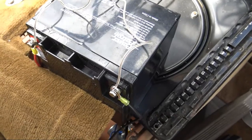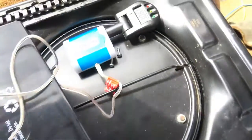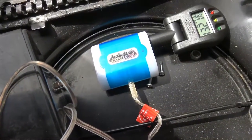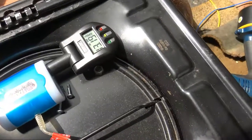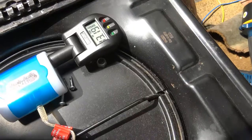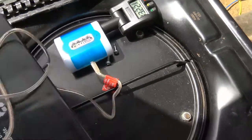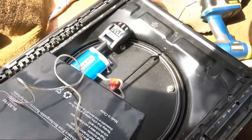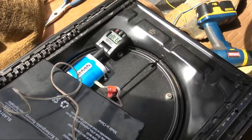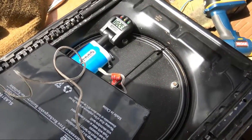To make sure we had it hooked up correctly, we spliced some wire off one of these cheap cigarette lighter adapters and hooked up a load meter. It's telling us we're currently charging — we're at 13.0, now 13.21 volts — so we are getting power to this battery. It'll isolate once it shuts off, so we know it's correct. It'll run its own current and won't drain the main battery when off.